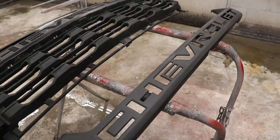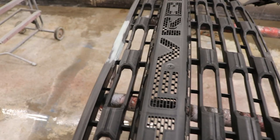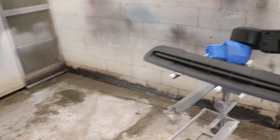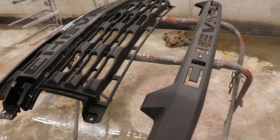So after a lot of sanding - and this thing actually comes apart because we need to paint in different colors - we're going to primer it and get primer underneath it. We took the grill apart, got that pulled out, heated it, and used a little bit of plastic resin stuff and it's looking good. We're going to primer this thing and we'll probably have to put a really thick coat to fill in all of that, and the mirrors too. First thing we're going to do is actually put plastic adhesion because we want the paint or primer to stick really well to it. So we'll put that down, maybe two coats, and then it's ready for primer.